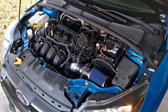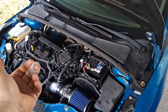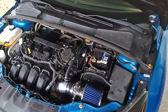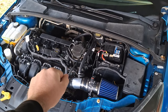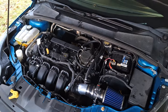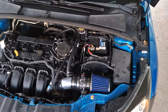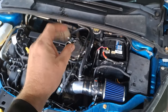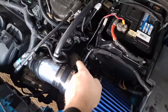If you have the dual-clutch transmission and you're mechanically capable, or have money to spend, go ahead and pull the transmission out. Get a LuK rep set — I'm not a sponsor — and what that is, is a kit that includes the clutch, the forks, the slave cylinder, and the hardware. You can get it on Rock Auto for about $600, and it's not a difficult transmission to work on. I've got a playlist full of videos for the Ford Focus transmission. So the dual-clutch transmission: in order to make this car bulletproof reliable, the LuK rep set is OEM parts for a discounted price. That covers the clutch, clutch fork, and slave cylinder, which are two bearings on a little tower in there. And if you've got the money, two brand new Ford clutch actuators — the little motors on top, you can see that one right there.